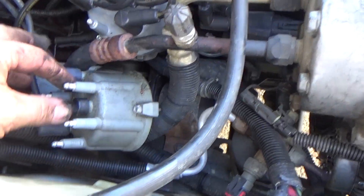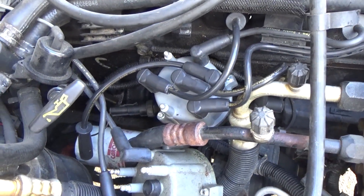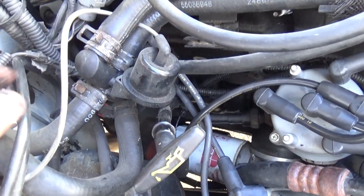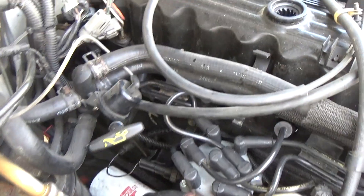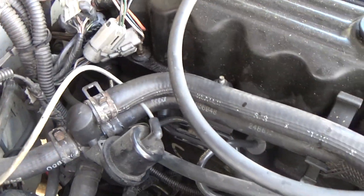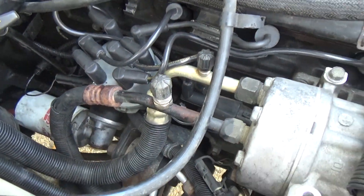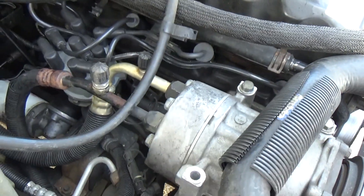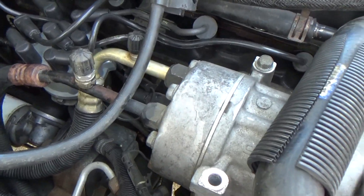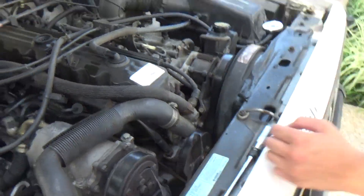While you're going, just transfer your wires from one to the other, then you don't have to worry about firing order. We're up to number four. This one in the back is going to be the pain in the butt for sure. Got all the new plugs in — it wasn't really that bad. You can kind of slide down through here with a large extension to get that back one. Got new wires installed, new cap. The rotor — they gave me the wrong one. That's a shock from AutoZone. I didn't look it up before I went down there, and that's my fault, because they can't ever give you the right parts. Got the new coil wire hooked up, so we're going to start it up and see if it made any difference.